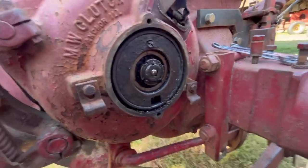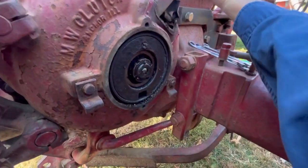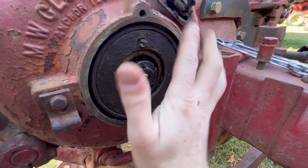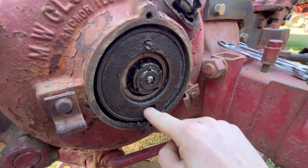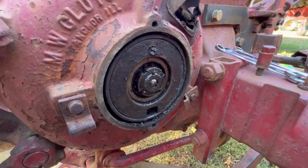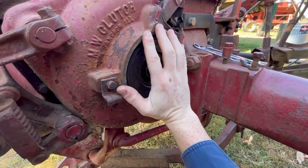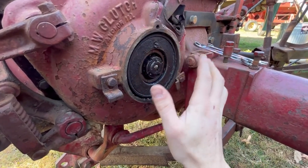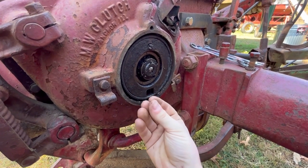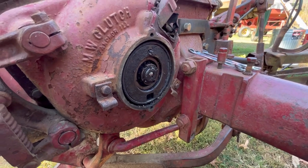We got the cover off of it, which is just that. It's got two bolts here and here, and then these two clamps which keep it from rotating — it's got a piece that sticks in here that keeps this from rotating. There are two pieces in there that rotate: an outer piece that stays still, and an inner piece that rotates with the lever. As they rotate opposite directions, they expand, and that's what pushes the clutch disc into the brake drum.